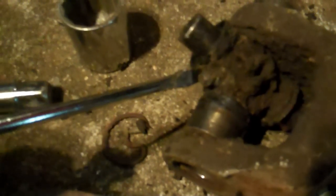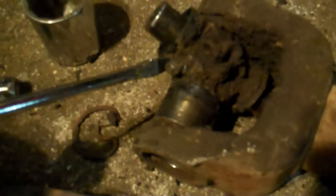You can't get the cap off because that grease fitting — not all U-joints have the fitting on the cross, some have it on the end of the cap like the Moog ones I'm putting in. I use Moog high-dollar U-joints; I don't like breakage. But anyway, this grease fitting bottoms out.